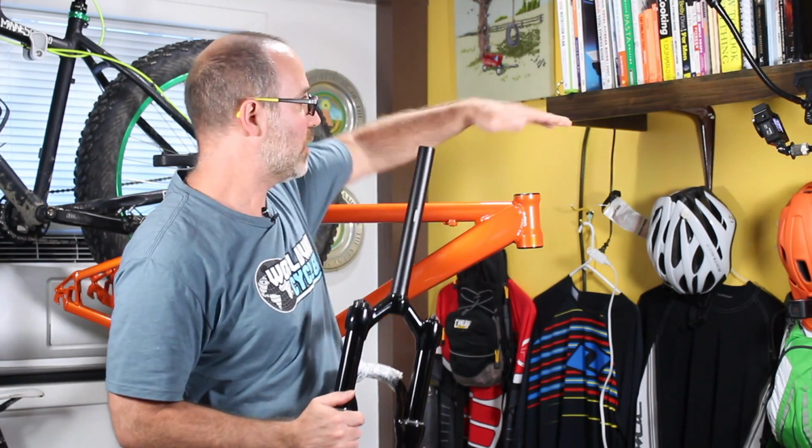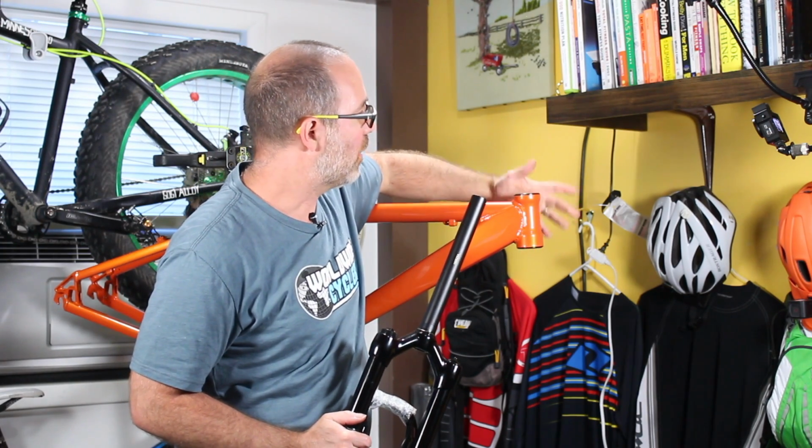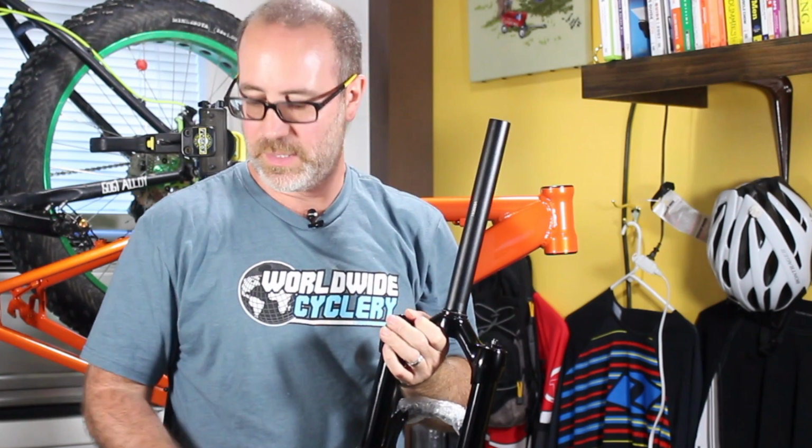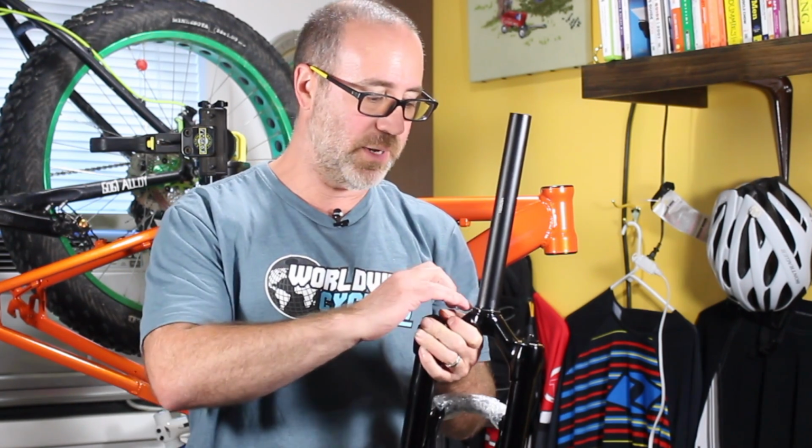All right, that's all it takes to install a headset. I told you, it wasn't going to be that big a deal. We used the headset press to press in the cups. Okay, it worked out pretty well. And we used, let's call it the bearing race setting tool, because that sounds a lot more technical than the little metal thingy that you drop down on top of the fork. And that put in the little bearing race over here.